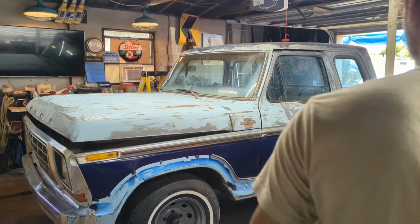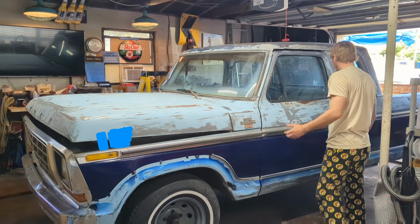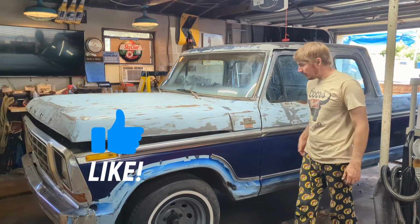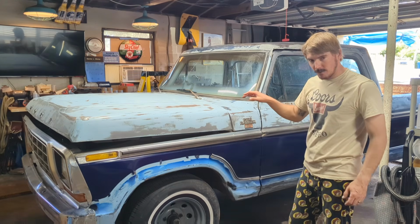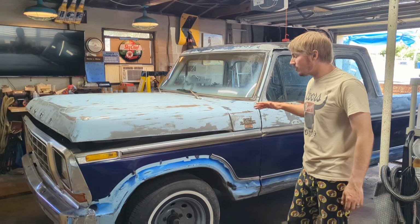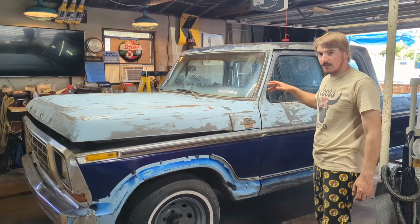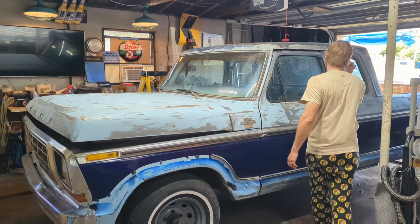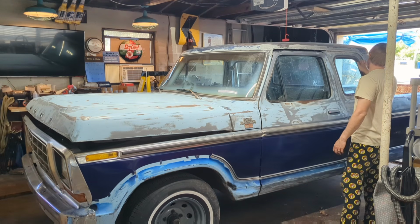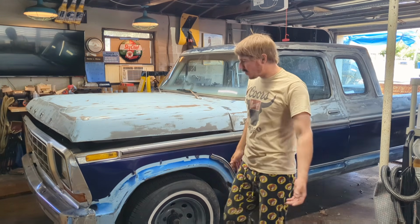All right, I spared you some of the less exciting stuff. The truck's in the garage. I went ahead and 320'd the whole thing, so we 80'd the real bad spots, 180'd the whole truck. Went through all the Bondo, did it, 320'd the whole truck, including the Bondo, and I had to get creative and use my Dremel to get in these window moldings, and they're not perfect, but I think they're okay.